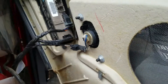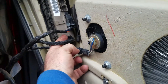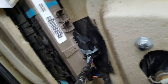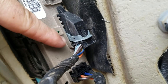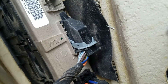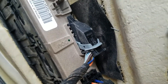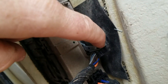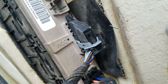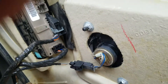Now you've got a plug that goes to what I believe is a tweeter — that one's pretty easy, you can just push it in and it'll pull right out. This next one right here you just push in and pull out. Then you get to this one, which gave me a little bit of a headache. You'll see it's got like this silver gray swivel-looking thing. You can push that down, and when you push that down this part slides up, and when it slides up that pops right out. So push that part in, slide this up, and that'll pop right out. And then this last one right here is easy — you push the top in and pull it out. Once you do that you can take the panel all the way out of the way, which just makes it a lot easier.